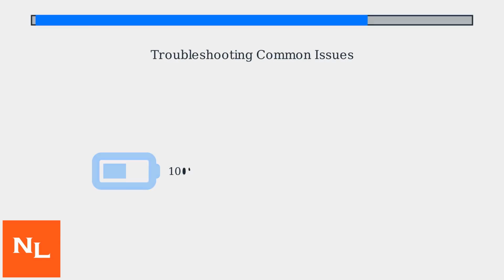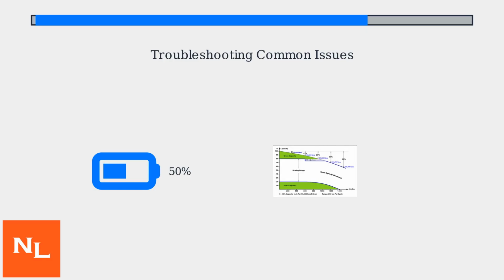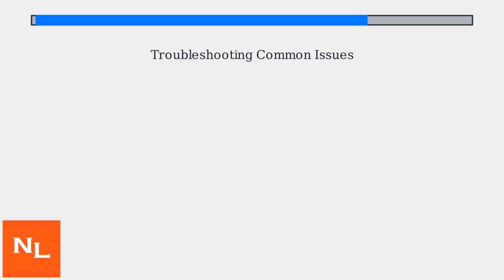If the start-stop system isn't working as expected, first check the battery's condition. An aging battery, especially if it's not an AGM type, might struggle to support frequent restarts required by the start-stop feature. Also, ensure that no warning lights are illuminated on the dashboard, as these could indicate a related issue. For example, battery or check engine lights might signal problems that affect the start-stop system. Software updates are available through Nissan's app or dealership service to address issues like false starts or delays in restarts. A 2024 firmware patch improved battery monitoring to reduce unexpected restarts.